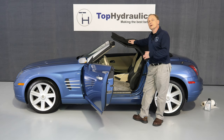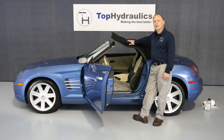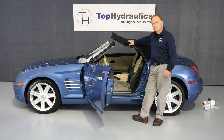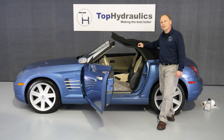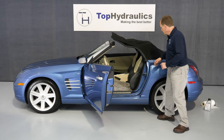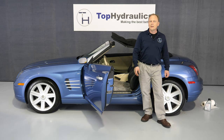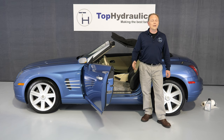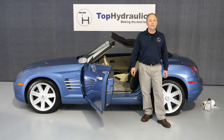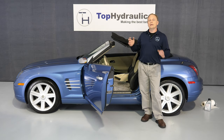Just as proof, I will cycle the top in a moment. We don't normally work on cars — we did this kind of for fun and to show you how it's done. It's good for the Crossfire community so that you can help yourselves. There was nothing super difficult. All the tricky parts we have shown you — there were some tight spots on the main lift cylinders, you had to drill out a rivet on the bow tension cylinder, and the pump was a little clumsy to pull out, but in the end there was nothing difficult here. You can do it all with a little bit of patience. In fact, we've had one customer who did it with use of only one arm and still replaced his cylinders.